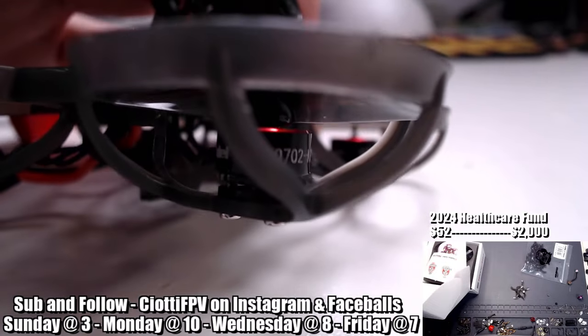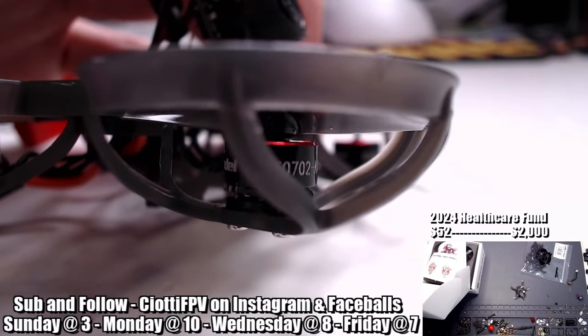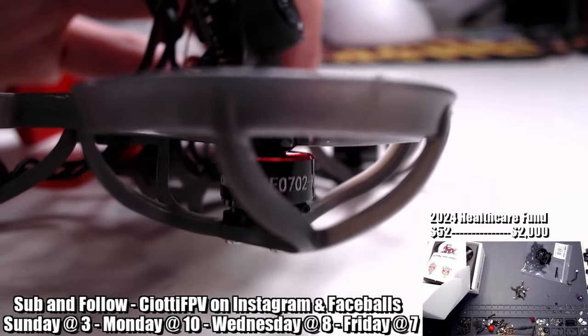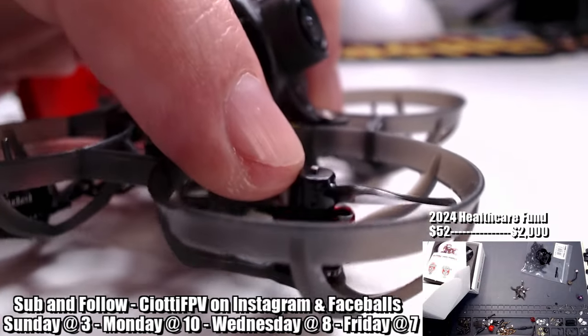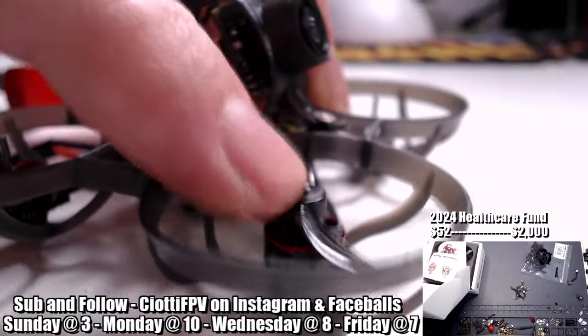And then when you look at the bottom of the propeller, you want almost no gap between the bottom of the propeller and the bell. This is going to be so much more durable because it's a shorter lever, right? Less leverage on it. That's what you want to see.